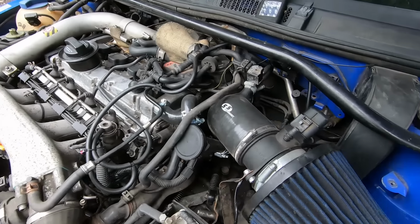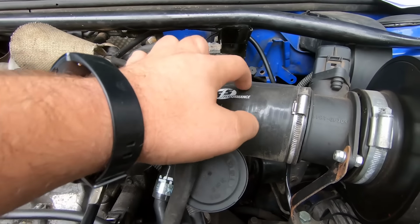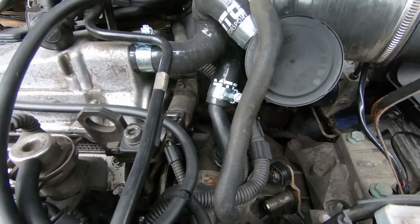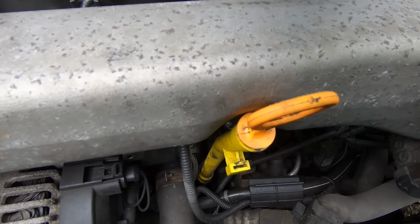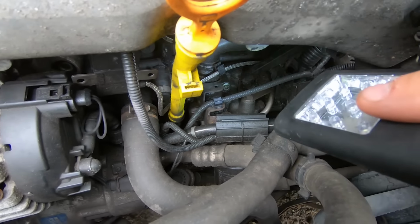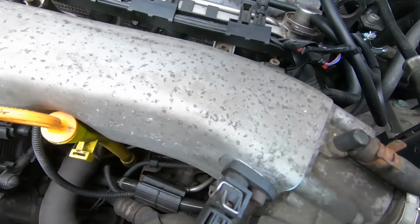And the other thing, while we're in pipings, common failures is the pipes fail. Now you can see here I've got silicone, but some of the existing pipes, to be fair, I've replaced quite a few of these, but underneath here, let me torch again. So this is why it's handy to have the torch. So underneath here it looks quite sweaty. It's a bit oily, and that is because it had loads of failed piping.